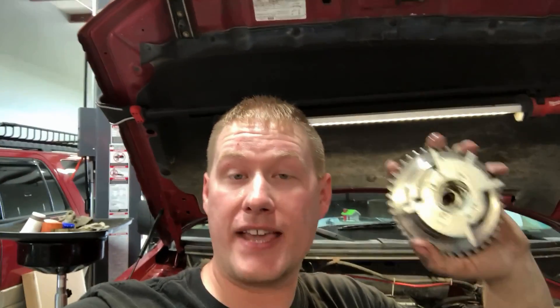Case in point: the vehicle behind me went ahead and did a full timing set himself — followed my videos, kudos to him — but he used the cheap aftermarket kit and phasers. The vehicle lasted about an hour and it was throwing codes for the cam sensors being intermittent on bank one and two: P0340, P0344, P0345, and P0349. The cam phaser was coming apart, wasn't even locking into place, so the signal was erratic. I had to go back into this one, put in Ford phasers, and redo the timing set.